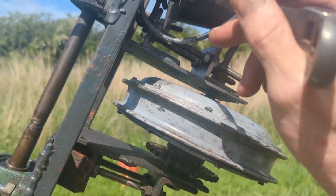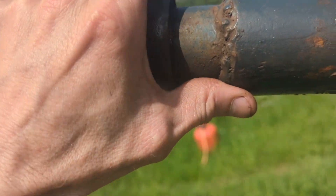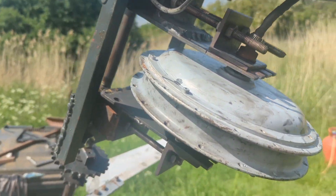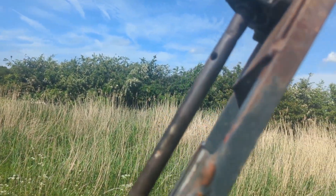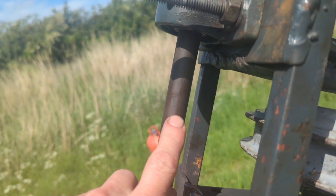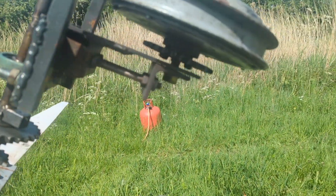This time I've got it down I'm going to change the angle of this so it's tighter and flatter. The other thing I'm going to do is put some weight on the back of the tail. One thing I think I can do is drill some holes, put a nut and have a flat bolt that goes through and tightens it up a bit — it'll still have to give enough clearance to move around but that might help. I have cut out a couple of tails which can go on the end here. The purpose of this is to get the blades in the best position running sweetest, and then we can combine the electric motor. You could have some kind of rubber roller attached to here — you'd want to keep the water out, but that's an idea I'm interested in.